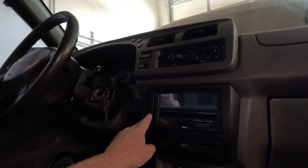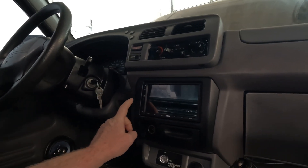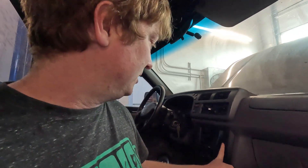We've also got the seven-inch Android head unit. The benefit of this is we'll be able to pull up LeafSpy, which is a free app you can use to monitor any Nissan Leaf. You can see the battery health, all the different cell voltages, battery temperature, amps in and out, kilowatts — all that stuff through LeafSpy, right here on the head unit.